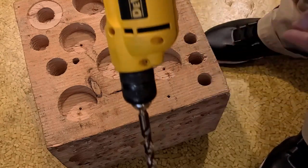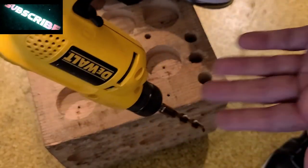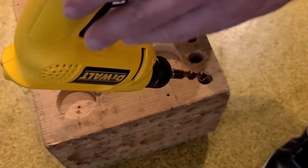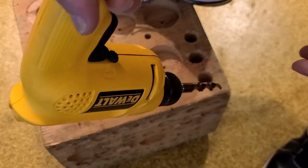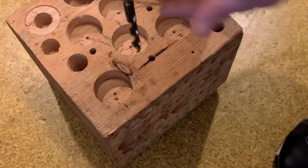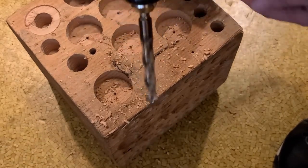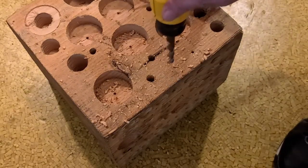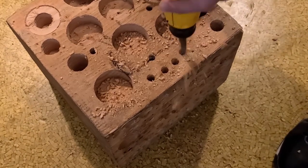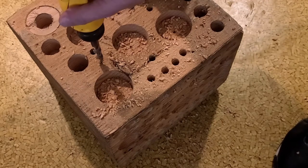It's nice to see an oversized larger bearing right on the front. Let's do a couple of drills — here with a wood block, I've put in a half-inch bit. These would be better quality than Harbor Freight, and I'd certainly recommend getting one of these DeWalts if you just want a general reliable drill you can hold on to for years. Half-inch twist drill just to show you — pretty quick even at 2500 RPM. These progressive-flute DeWalt bits just grab and want to screw themselves into the wood.